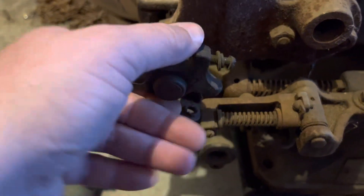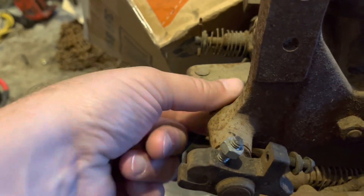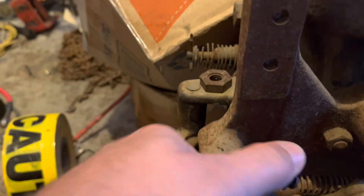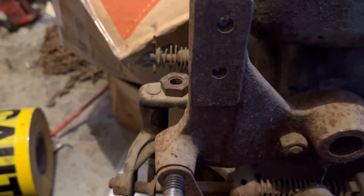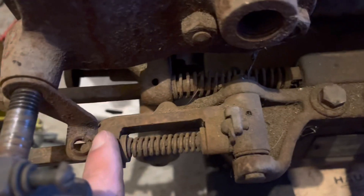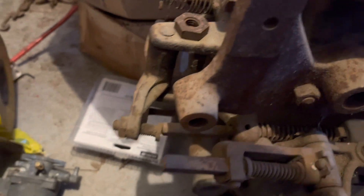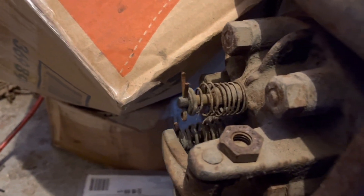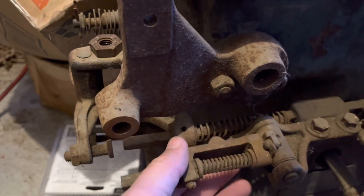I went back and looked at some videos on my other engines — this is all screwed up. I noticed there's a nut back here that's coming off with just my fingers; it wasn't even tight, and that will allow me to pull this whole shaft out. The thing has pressure against it from the spring, so when I pull it out... yep, there it goes. Now if we turn over the flywheels — now we've got valves that move, which is good news. The intake valve moves freely, and there's a nice little spring under there that's all springy.